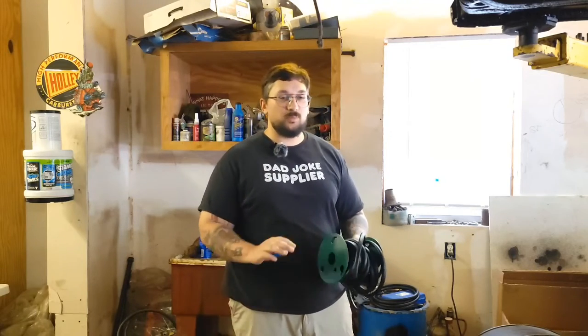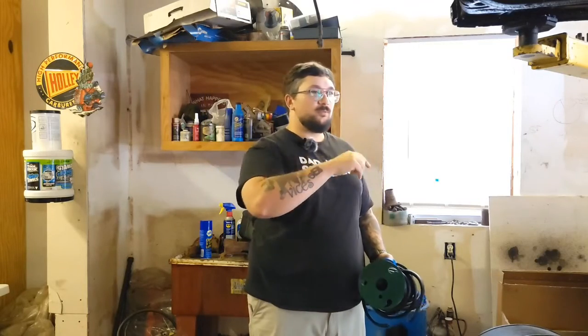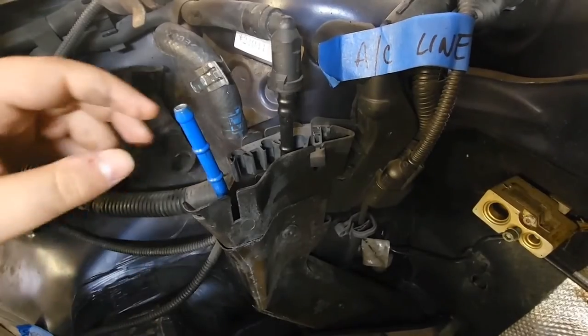It's the next day. We ran into a little snag with the fuel system — it turns out the connectors on the hard fuel lines aren't really staying locked in place, so we had to go with some new line. We've got some Gates Barricade 5/16" hose; it's good for 50 psi. This is not a high pressure system so it'll be more than enough. We're going to mark the return side with blue electrical tape so we know which is which, and run it from the fuel tank up to the fuel filter, then from the fuel filter down to the fuel cooler, and then the fuel cooler back up to the fuel tank.